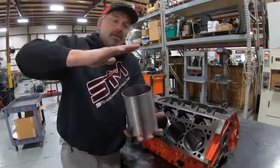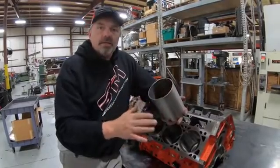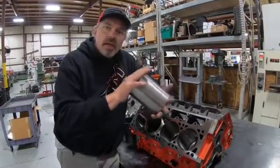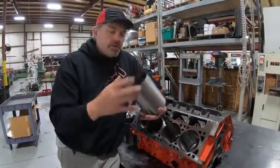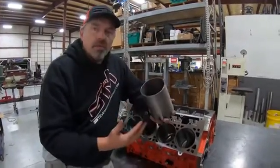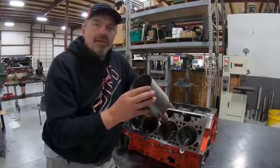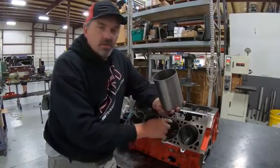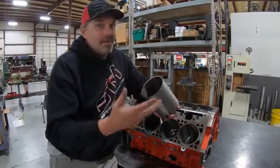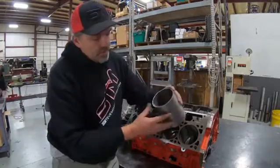When the head gasket and head go on, it pushes down against the bottom of the sleeve so the sleeve can't go anywhere. What you don't want is a shop that bores all the way through and relies solely on the press fit to keep the sleeve in place — that doesn't work with head gaskets, especially with o-rings. It ends up pushing the sleeve down and the thing doesn't seal. So we have that ledge down there plus a thousandth press.